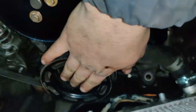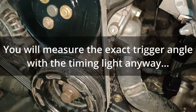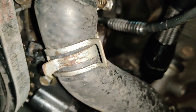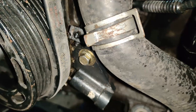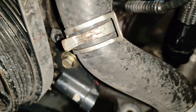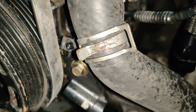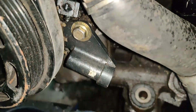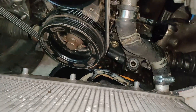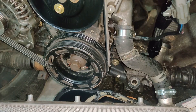If you want to be precise you can use a degree wheel mounted on the crank, but I'm just going to estimate it. There we have our gap with the missing teeth and that's about the first two or three teeth touching the crank sensor - while that's not very accurate, it is an estimation. How many degrees you've turned the crankshaft from TDC is your trigger angle.